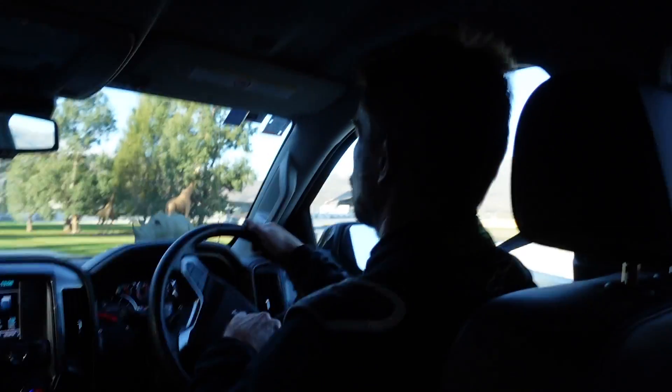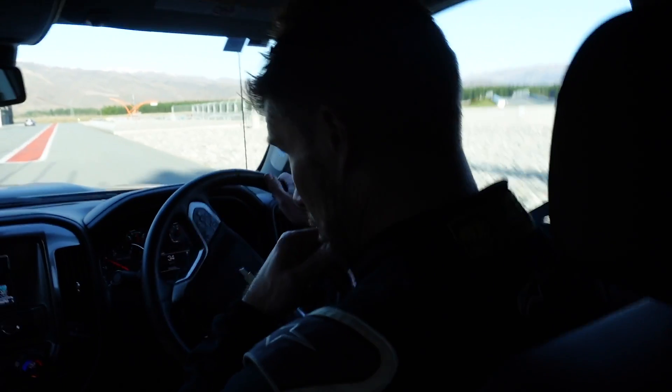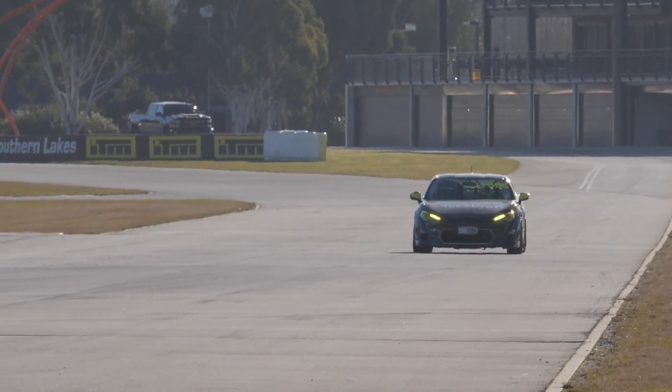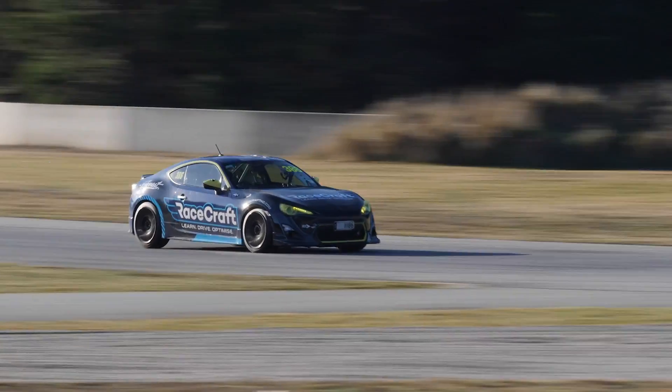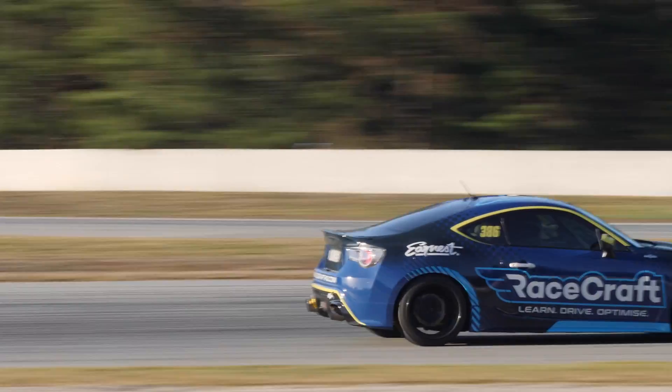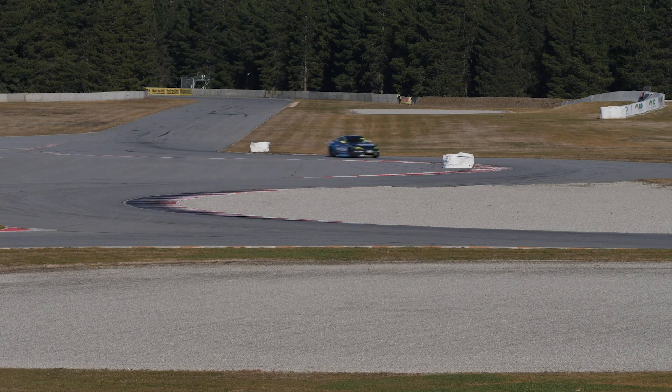It does actually feel really neutral — other than the fact that I can provoke oversteer at will. It does feel really neutral after corner weighting, which is good. We just finished up a few fast laps to analyse the handling and to be honest the car is actually pretty good. The key things we're looking for: first, is the car braking stably in a straight line, or does it tend to lock one wheel consistently? That's less of an issue with ABS, but we can still see if the car pulls in one direction. In this case the car brakes very well and in a straight line, so we're happy there.